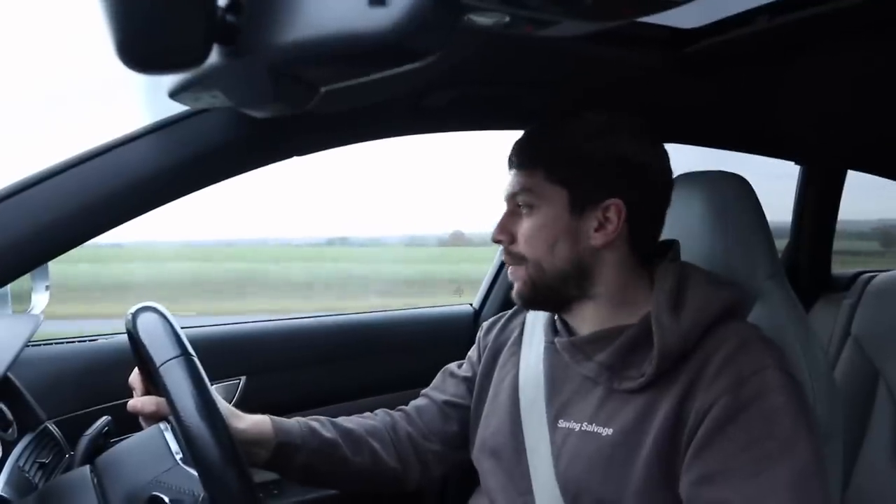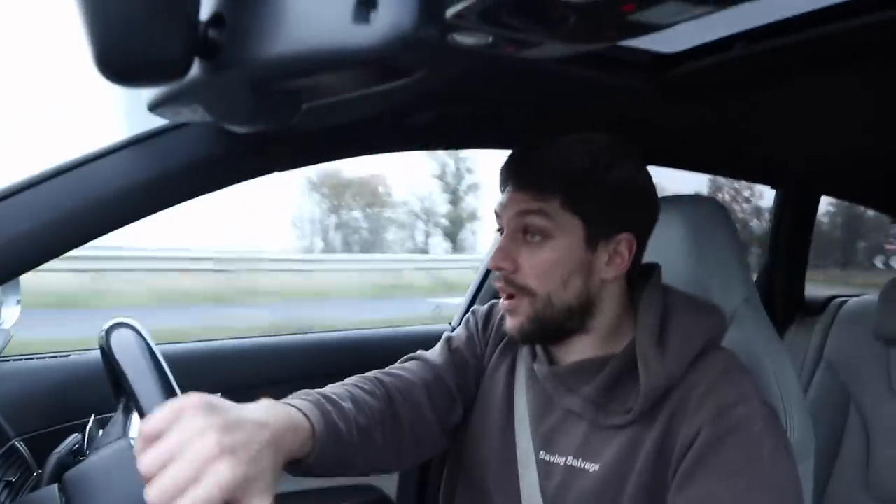I'm going to head back before anything breaks. Good news though - there is no smoke coming out the exhaust. You'd have thought if the turbos are gone it would be smoking no matter what. I'm hoping it's just the fact that oil had built up in the intercooler over time. Obviously the higher the boost, the more oil gets drawn up into the engine and therefore blown out the exhaust - it only did it at high RPM. And it's not doing it now, which is good.